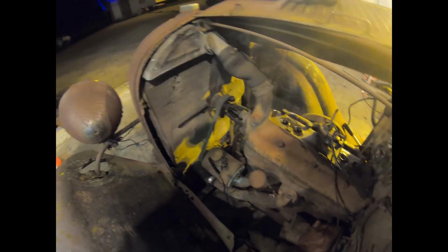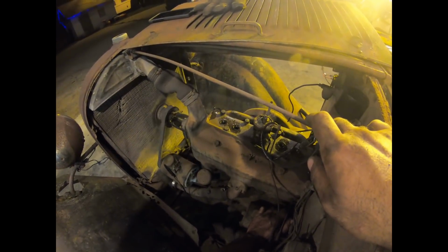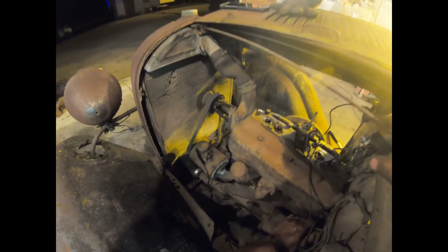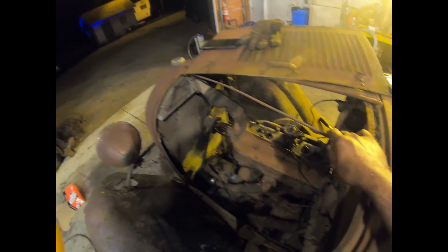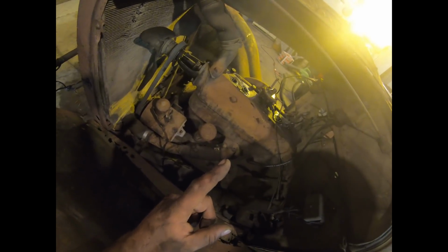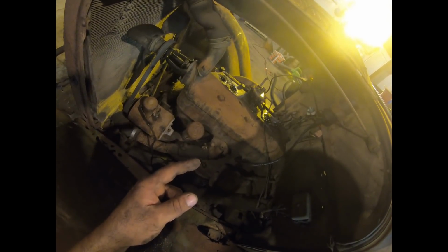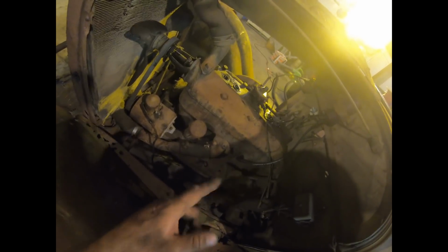I'm gonna grab my rod here, watch the fan, obviously. Oh yeah. Wow, 12 volts really sends that 6-volt starter around, doesn't it? Awesome. Because this car is positive ground, I need to switch my coil wires around because the output coming from the distributor, from the points, is actually going to be the hot side of the coil, and the negative is actually going to be the switch side going to the battery. So I have to do that yet real quick too.